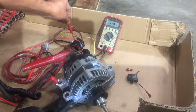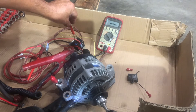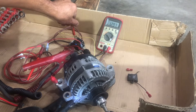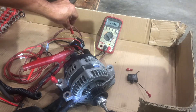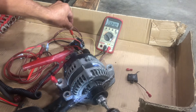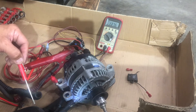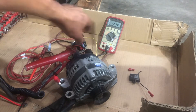Okay, as I'm turning the pot clockwise it's 14.4 volts and I can turn it down — now it's 12.9. I usually leave it at about 14 volts. You can hear the drill slowing down as the alternator grabs more load. Let me get the screwdriver back in the slot and send it back to 14. I usually leave it right around 14 volts.